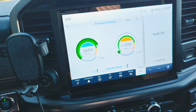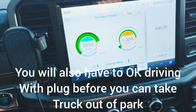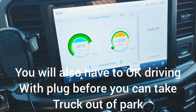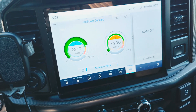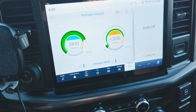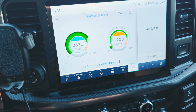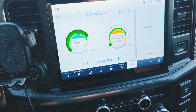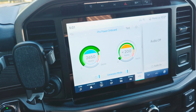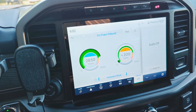That shows it working, and it does a great job. You can go down the road like this. I have 10 kilowatt hours of battery on the trailer — 800 amp hours at 12 volts — and basically I could take that from zero to full in about two and a half hours. With a truck like this, you have unlimited power for your camper. Hope you found this helpful, and I'll leave links in the description below to all of the various parts that I used.